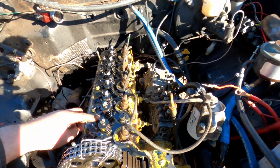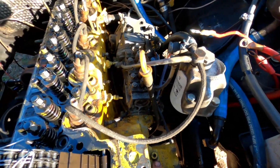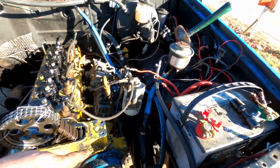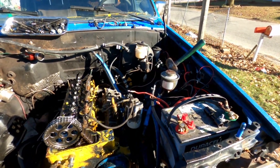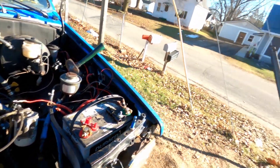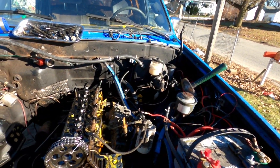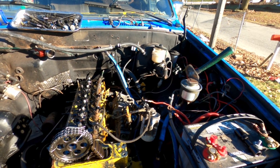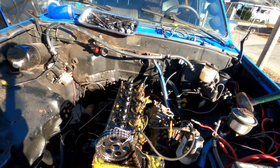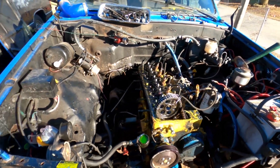I have to get the glow plug wires unhooked and then the main head bolts — what's left are these triple squares, and there's still a buttload of them. And to be sneaky, there are one, two — and I thought there was one down inside also — five-millimeter Allens holding the thing down for no apparent reason. It's kind of late in the day but I'd really like to get this head off today and solve the mystery of what's going on so I can make a plan.